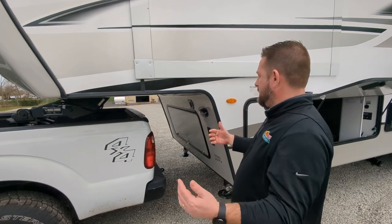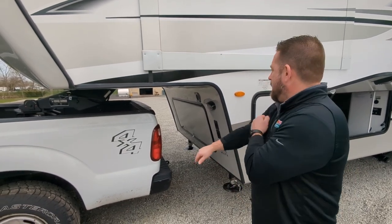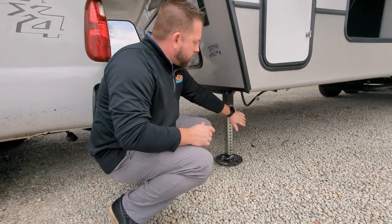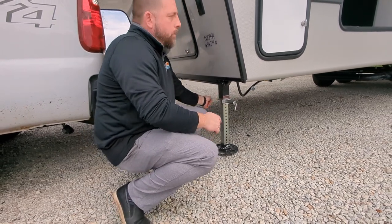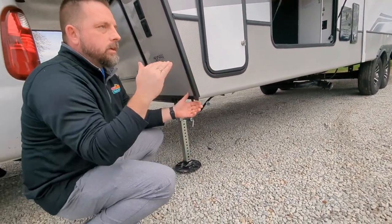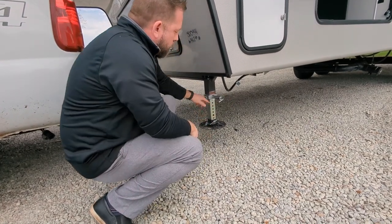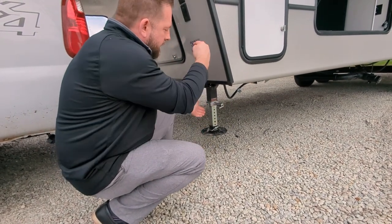Now we can pretend like we've just backed this into our spot. We made sure everything is level enough for our auto level to work on this, and we're ready to drop this off the truck. The first thing we'd want to do is drop these legs down. We always want to make sure the pin goes all the way in — you can see it didn't come all the way through just on its own when I first did it. So always make sure that it goes through all the way. Where we're at on level ground, we don't have to worry about leveling so much, but you'd want to look at your terrain. If you're on a downslope, you may want to pull the pin, count the holes, make it even on the other side, and then run the legs down from there to give yourself some play to move up or down if needed.